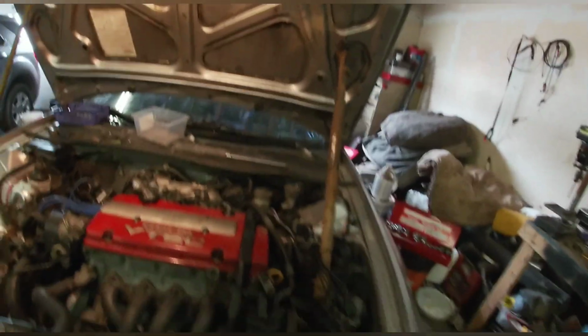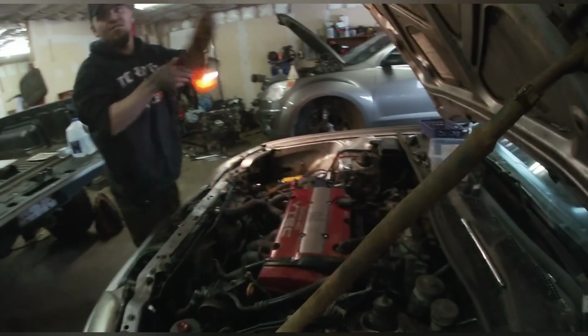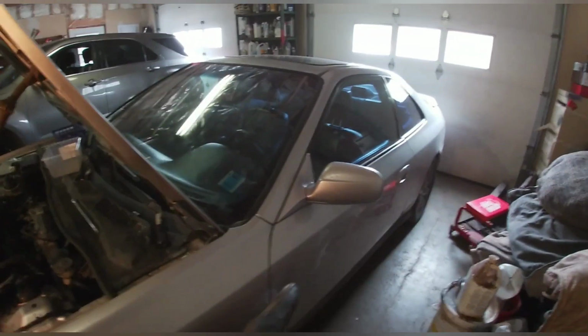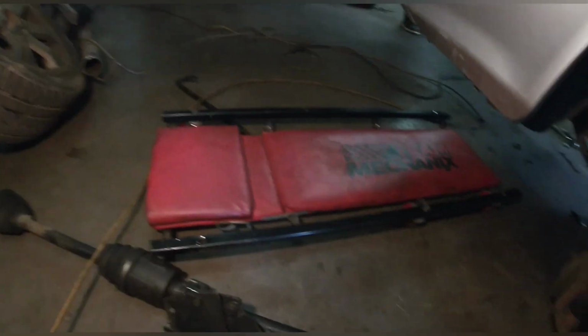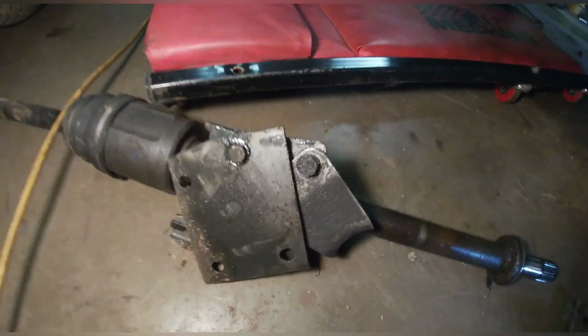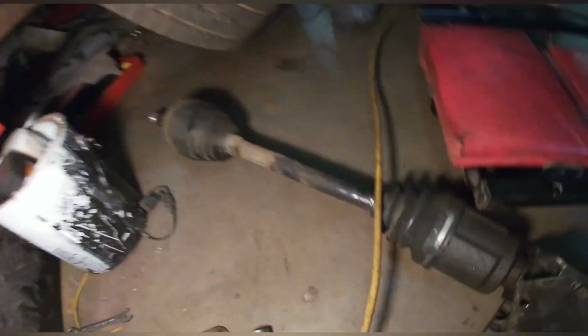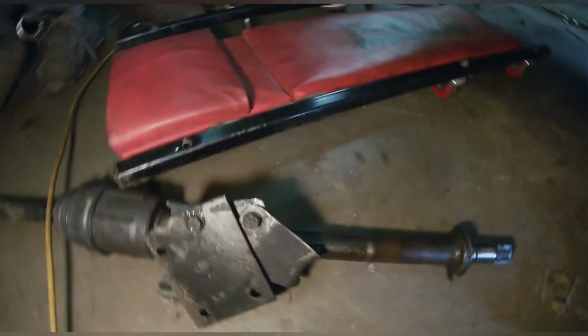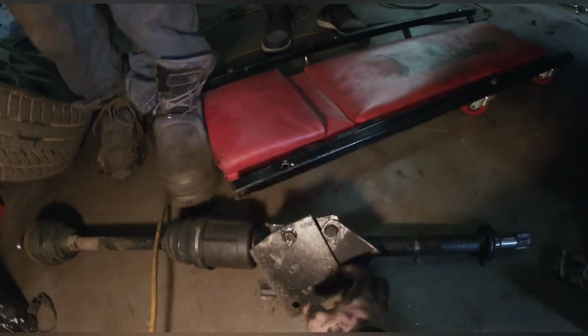But what we're gonna do, we're still gonna change the tranny. We're still gonna put the regular base model 5-speed. Actually, the one that he has is LSD, we just noticed. So that'll be good. But we've got to figure out a way to keep the half shaft in the car. LSD doesn't give us anything good unless we've got a steady half shaft that can keep an axle in the car. So I just tried to basically convince him that either he needs the right motor or I'll make a real bracket.